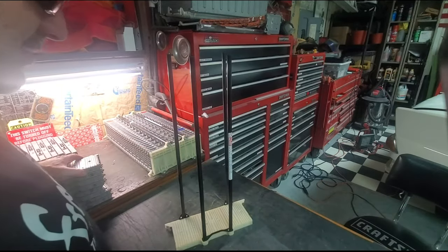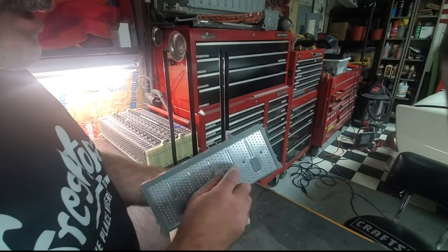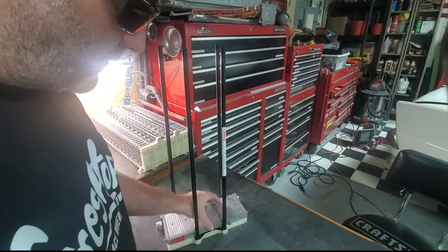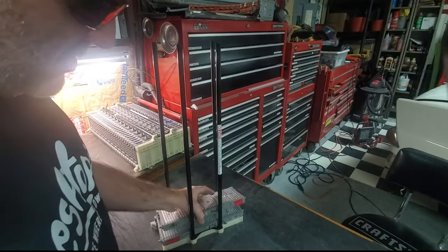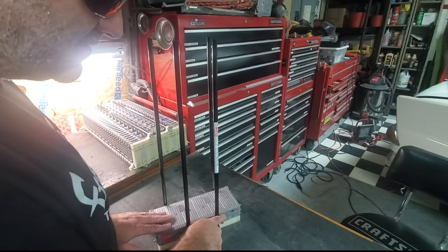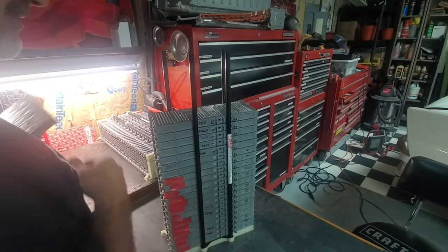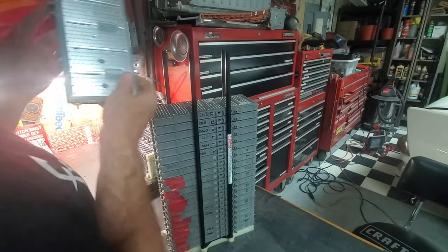If you have your replacement batteries in hand, you're going to want to do a thing called balancing, and that's what I'm going to show you here. All of these battery packs have a little divot on one side and a little nipple on the other side that lock into each other. You'll notice when you took this apart that the negative from one battery pack was right next to the positive of the other. For this balancing exercise, we're not going to do that — we're going to have them all faced in the same direction, so all the negatives will be on one side and all the positives on the other. Whether stacking in the same or opposite directions when putting it back together, you'll feel the little nipples lock in with those dimples and know the pack is seated correctly.